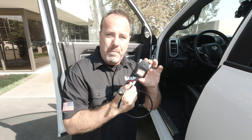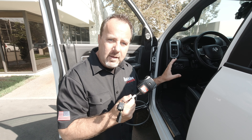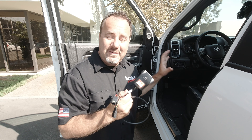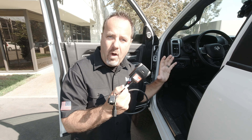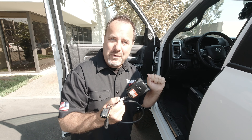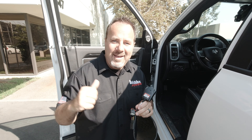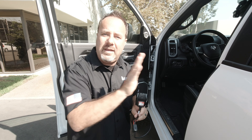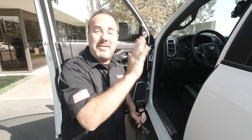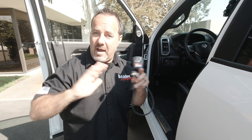So if you connect some other module and try to power it off that pedal plug, it will freak out the ECM on the truck or the car. It'll tell the ECM hey, there's something wrong with the pedal, and it will disable your pedal. It sends you into limp mode — not just limp mode, sometimes on these big trucks you still have a little bit of throttle — but when it thinks the pedal's dead, it disconnects the pedal altogether. So you have nothing.